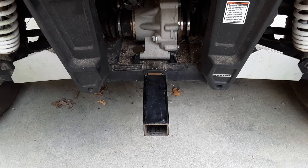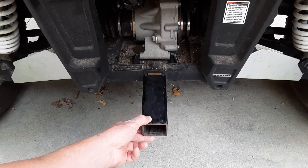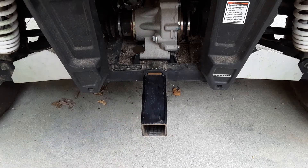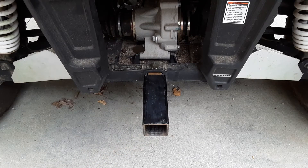This is the issue I had with this tow hitch adapter. As you can see, it's not very tight in there and it can bounce around side to side and up and down. I was using a bed extender to carry things up and down a hill. And even though the extender had a caster mounted on the end, it was still dragging on the ground because of the length of the extender — this would bend all the way down. I didn't have access to any welding gear or anyone nearby that could weld this in there tight. So what I came up with is this bolt-on version and it seems to work pretty well.